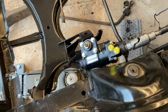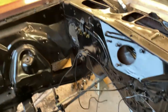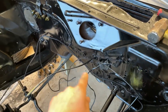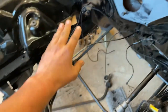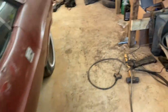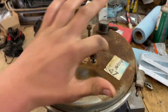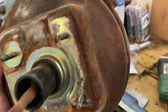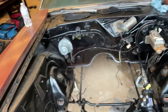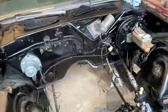It's the next day. After sleeping on this and thinking about the project, getting this gearbox in here kind of motivated me to get the rest of this stuff back in. Today I'm going to get the blower motor back in, the booster, and probably the windshield wiper motor - hook everything back up so when I want to get the motor back together I can just throw it in. I just took the wire wheel to this booster and I'm going to repaint it black - you can see the wire wheel makes a big difference. Just do a couple passes and it should be looking good. It looks much better. I decided not to paint the blower motor or the windshield wiper motor black because I thought the aluminum really popped there.